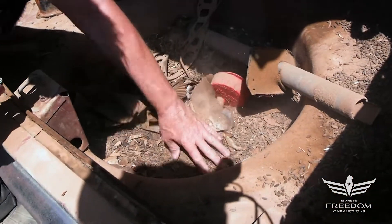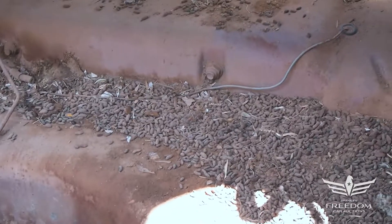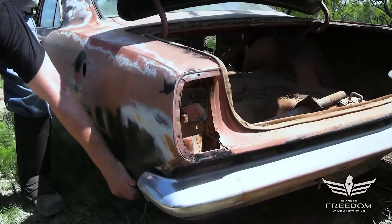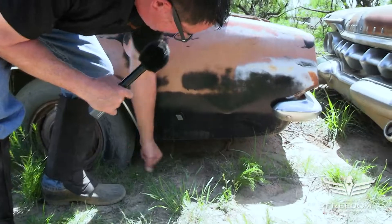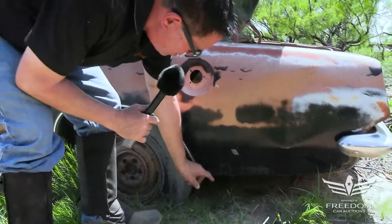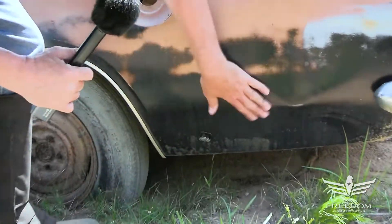The spare tire well is solid — there's no hole, which is good news. These are usually paper thin and you can put your foot right through to the ground. Over here on the driver's side, the quarter panel is very, very nice. No damage, no crash repair, all steel. There's a little bit of bubbling — give it five years and that will be a hole — but the bubbling is just beginning. That's first generation rust, not Bondo. Nobody's been in here trying to hide anything, so it's a very honest quarter panel.